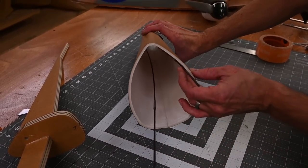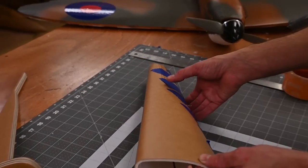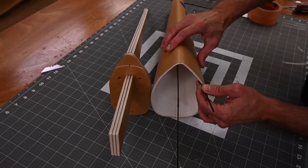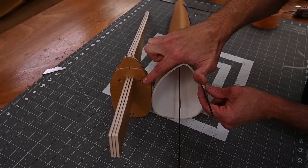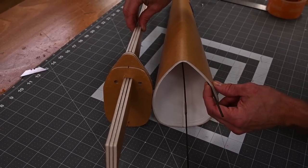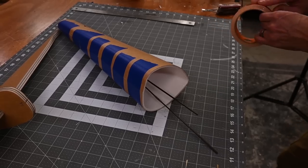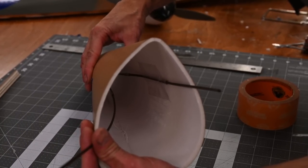In order to get the proper position, I'm going to lay this former right beside and make sure I've got my height pretty close — not too low, not too high. This pushrod housing on either side is going to be passing through one hole, and the other through the other. So that height looks pretty good. I'm going to hold it in place, squeeze it just a little bit so I've got a mark, and go ahead and apply some tape. Now that's taped in place, let's do the same on the other side.